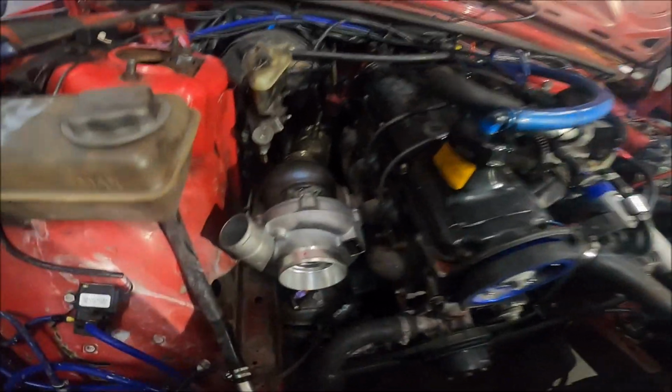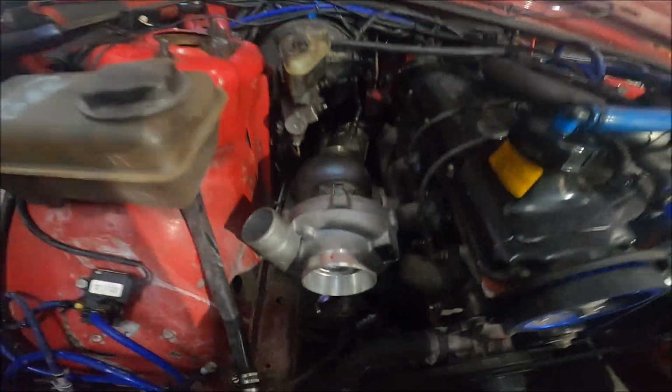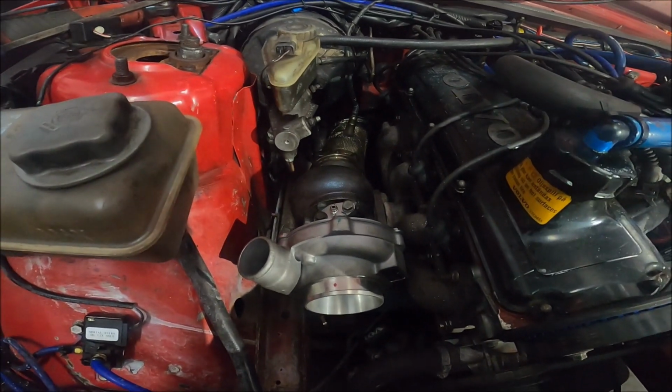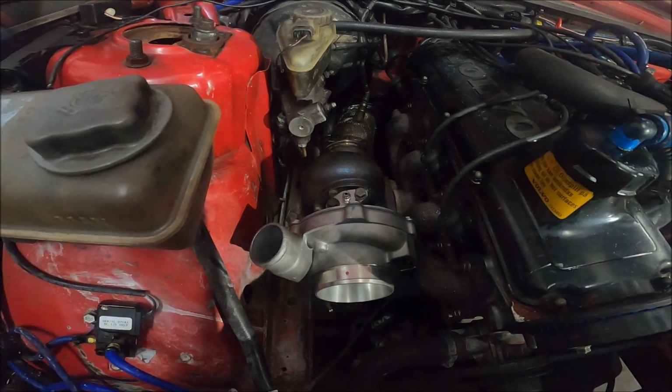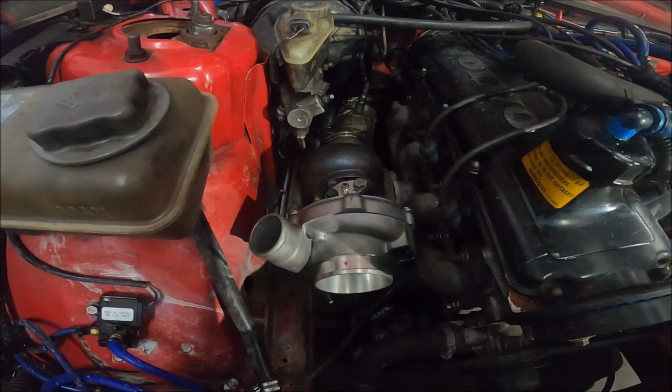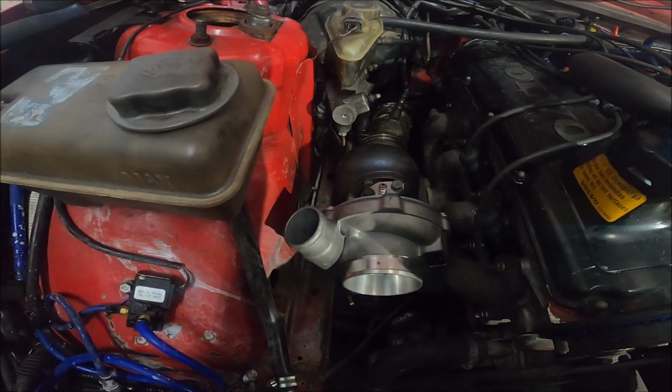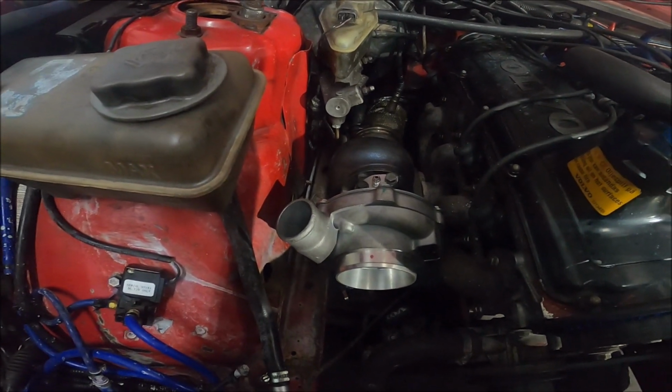And yeah, a couple of minutes later, the GT30 is on. Despite being able to flow more air and being bigger internally than the old turbo, it's slightly smaller externally. It's very compact, so it fits a lot easier than the old one, which is nice.